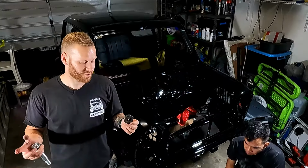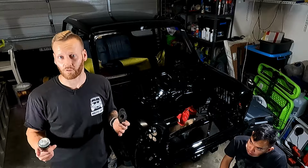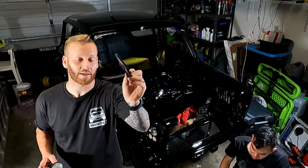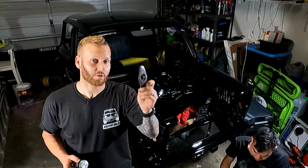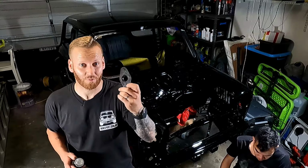All right, so we're just about to install the front subframe. Now, with a Rover Mini, they can be mounted with rubbers or they can be solid mounted. Essentially, what we've got here is a rubber mount. I'll put a link in the description where you get these from Minisport, and a picture just beside me. Essentially, this goes on the top of the subframe. So what we've done is put a little bit of rubber grease on there. That way, it helps it go on and prevents any sort of premature squeaking.